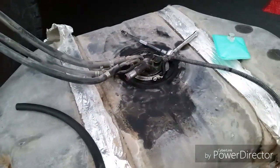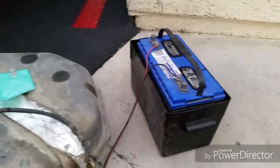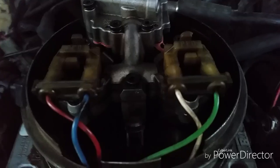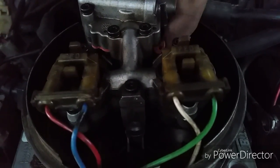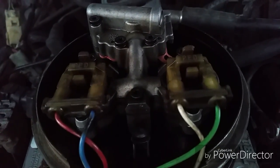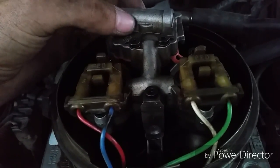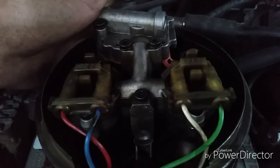I have the Walbro 255 hung in the stock fuel pump bracket, being fed from a 12-volt battery, and the pressure is smack dab at 14 pounds. I did replace the diaphragm of the TBI regulator — that's a brand new diaphragm — because I didn't really trust the old one. This regulator unit is factory adjusted. You can install an adjustable regulator, or you can drill out the old one to make it adjustable. I have done neither. It's just a stock unit.